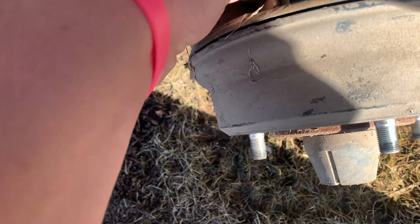There's some mouse feces right in here. This is where one plug goes in, the other plug goes there. So we'll get some new plugs, fill these tires, get tires back on, blow out the air filter, fix the oil dipstick, run some seafoam. This thing's got a half a tank, so let's give her a fire here.